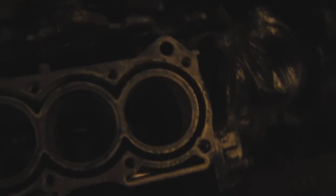So what was gotten done today: as you can see, the brand new water pump has been installed. There's the old one right there and there's the box still sitting there. I didn't get any footage of it, but I got the new bearings put into the connecting rods as you can see — the old ones are in the trash right there. I also got the cylinders all completely honed out. They all look uniform, they all look good enough for me, so hopefully everything should be good. Worked on this thing for about four hours today and hopefully tomorrow I'll get to putting those into the block, making sure everything on the water pump is all rigged properly. I still got to get the spring-loaded thing next to the crankshaft hooked into it to that weird long-looking nut. So yeah, that's really all there is to it. Everything's gone smoothly today and I can only hope for more tomorrow. Stay classy guys.